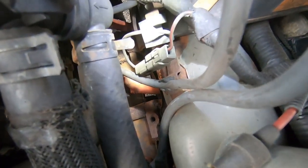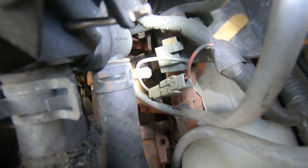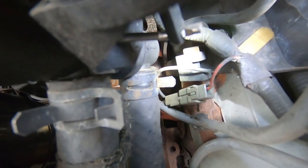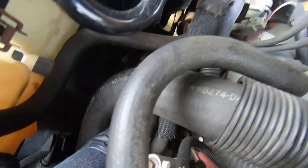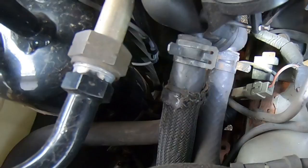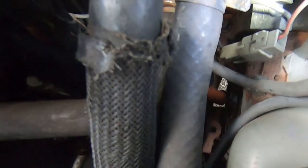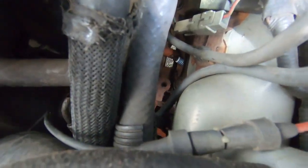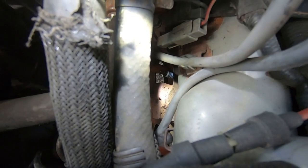If we come to the middle here, there is our second plug wire — that's the second one we're going to do here on the passenger side. I want to pull that out with my hand and then get the plug out. This one's going to be kind of tight to get your hand in. I'm going to go in the same way I did the last one, right through that hose. Yep, there it is — popped off. I went right through the radiator hose again and popped that second wire right off our middle cylinder.